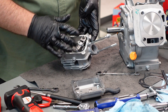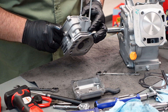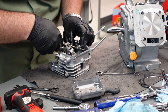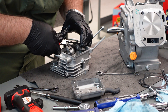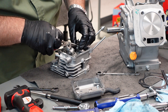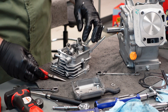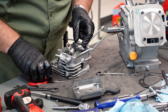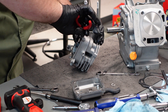Now your valve train: we've got rocker arms, lash adjusters, and then the valve train itself. What I'm going to do is disassemble this unit. We've got two C-clips here that hold the pin in place for the rocker assembly. You should be able to get a pair of needle nose pliers or a flathead screwdriver in for the C-clip. C-clips tend to go flying, so once you get it broke, put your finger over top to keep it captured or it'll fly and hit the ceiling. Then take the other side loose. If I had done the correct side first, it would have just fell out.